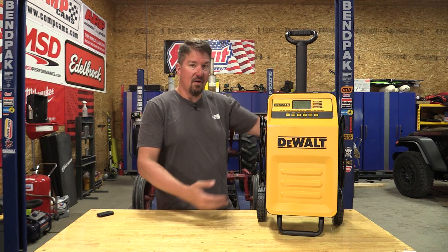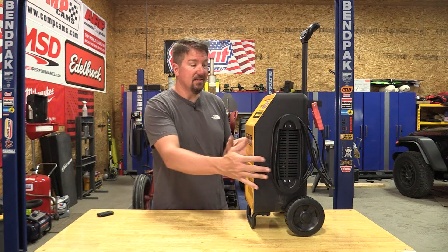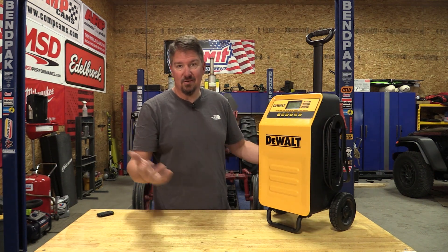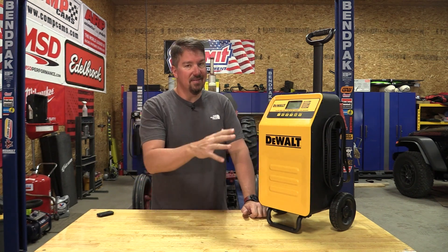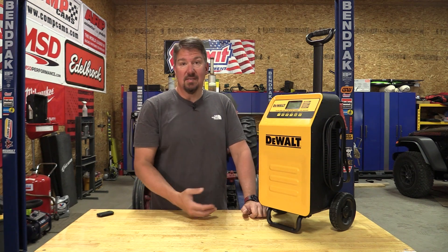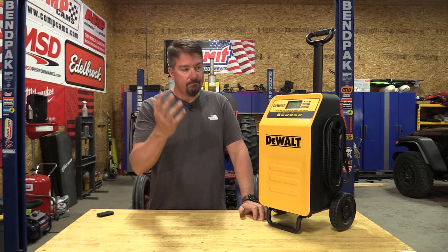Realistically you have six and a half feet on your battery cables going from the ground up into a car and then seven feet to a plug — it's rare that's going to work without an extension cord. That bummed me out slightly; I was expecting a little bit longer. Other than that, it looks decent for a shop. It's not the old battery chargers from the farm — much lighter, much less to it, and obviously doesn't have the power those things did. I mean we used to start large diesel tractors with them and no issue. This didn't start a four-liter six-cylinder motor.